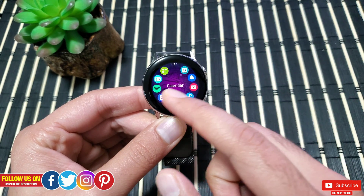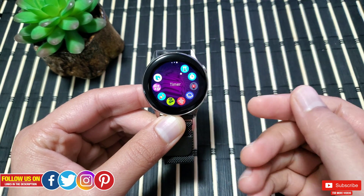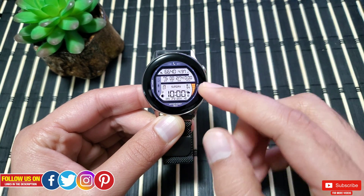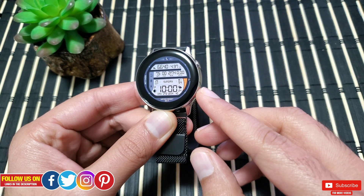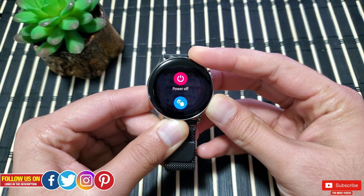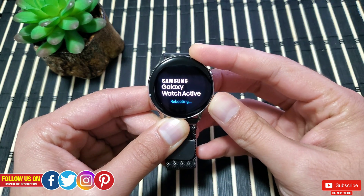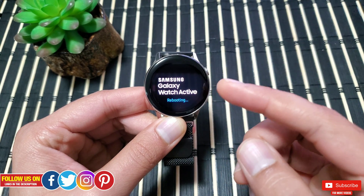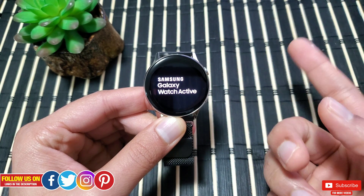In case your screen is frozen or an app is unresponsive and the touchscreen or the physical button does not work and you want to reboot or restart your watch, this is what you want to do. Don't worry — this will not format your watch, it'll just restart it. All you have to do is keep pressing the bottom right button until the rebooting screen with blue text at the bottom appears, and your watch will restart. This is the best practice for most issues you may encounter with the Watch Active or Watch Active 2.